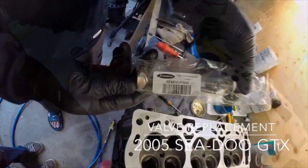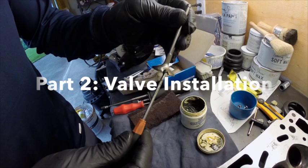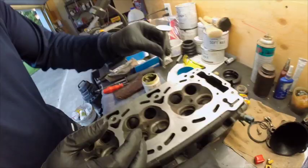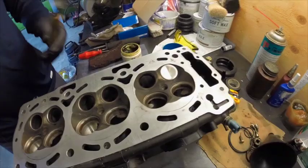These are our new Super Tech exhaust valves. I'm going to put a little bit of valve lapping paste on there. You don't want too much, you don't want this stuff getting everywhere. You just need it right on that edge of the valve. That's probably good right there. Point that into the cylinder head.